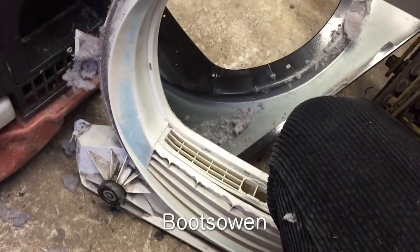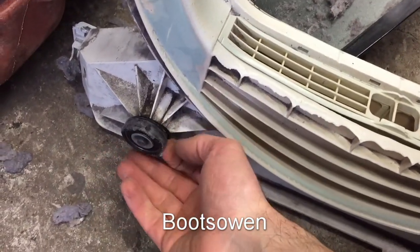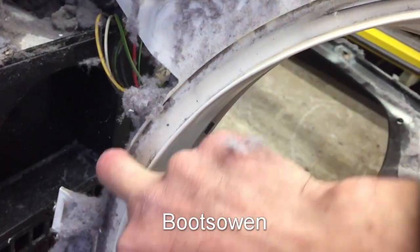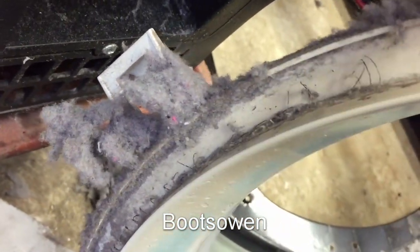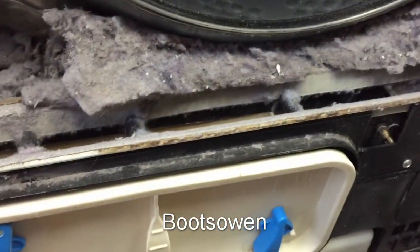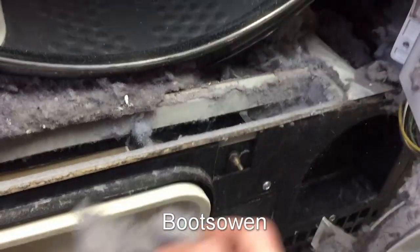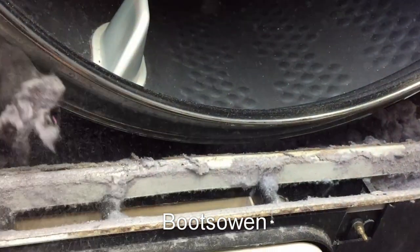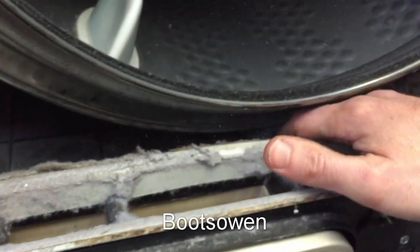I've taken off this plastic thing, and there are the rollers that it rides on. The bearings — they're not great, but they're fine, I think. There should be some kind of a felt thing in here, but it's not there if there's supposed to be one. There's some kind of fibrey thing going on there. A bit of a groove worn in here. It might just be some kind of burnt-on snots or something. But look at this — it's basically riding on fluff. Never seen anything like this. I'm just presuming the motor is mushing away down below, underneath all that. Bit of plastic that shouldn't be there. More fluff down the side.